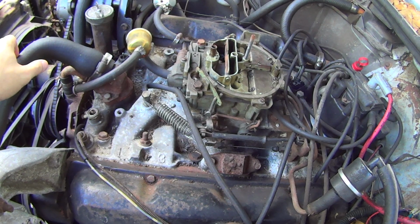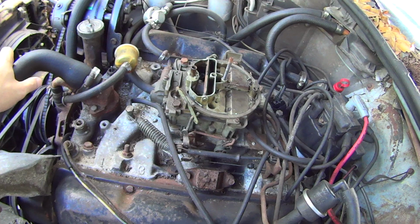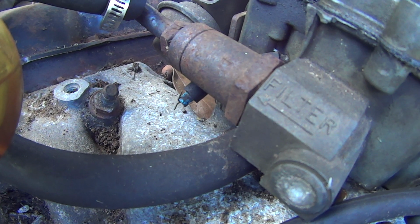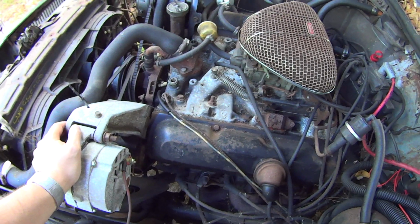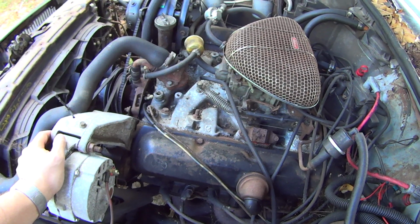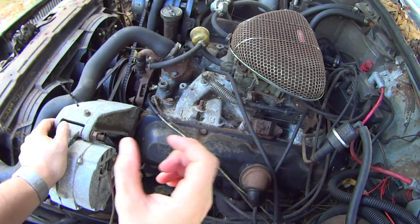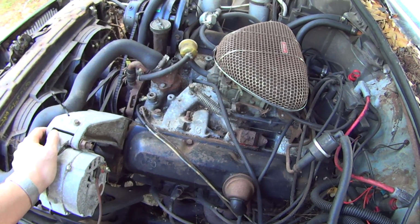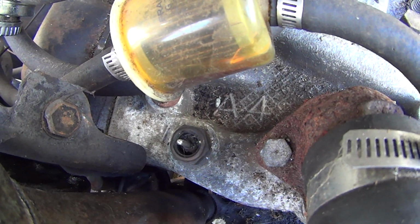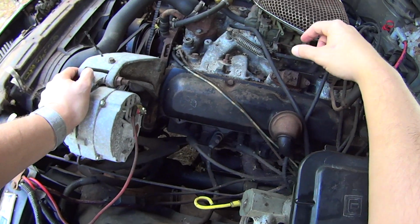This is the 1705-7213 AWP casting. When I did my initial research on it, the internet led me to believe it may have been one of the 800 CFM carbs. And just for good measure, there's your electrolytic capacitor used as a vacuum plug. The intake manifold is aluminum, and it came off of an early 80s Oldsmobile Cutlass 307, but it's not one of the intake manifolds with those tiny, tiny ports. That's the A5 casting. This manifold is the A4 casting, which has port sizes that more closely match the number 7 heads on this 350.